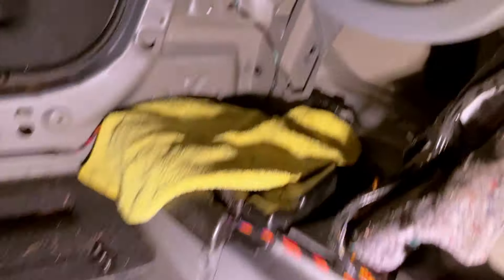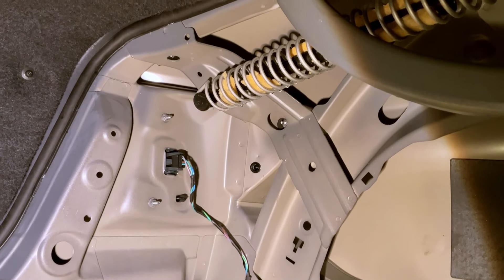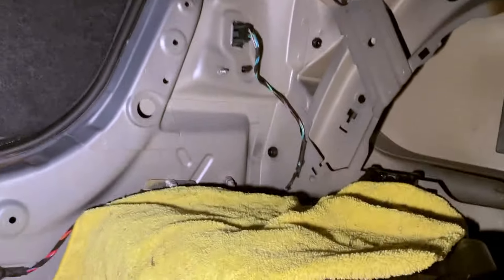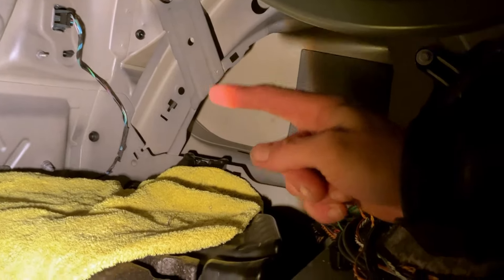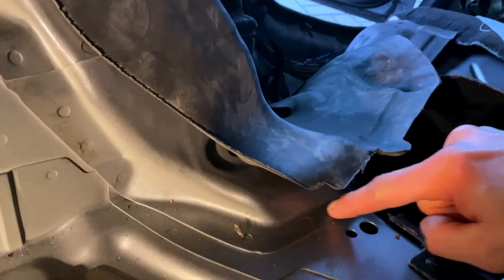If we then jump inside the car - okay, we can see it's dripping in onto the mechanism which does the boot area, and then it's falling into this section here. Believe it or not, that's the leak there. It's coming in here by this rubber, and then what it's doing is falling on the pad which is up against here and using that as a slide - because that pad actually comes all the way to here.